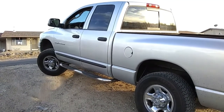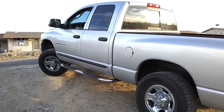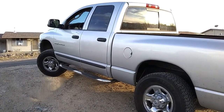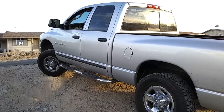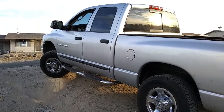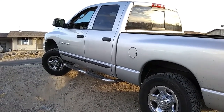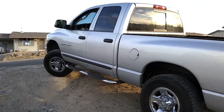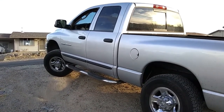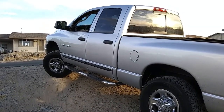Okay, so everything went back together pretty easily, just assembled in reverse. The torque spec for the face of the water pump was 18 foot-pounds, so those all got torqued down. One problem is, once we were complete, it started to overheat, so there's an air pocket somewhere in the system, so we parked the truck uphill and are running it now, hoping to burp out the air bubble. Outside of that, I think this is good. Have a great day.